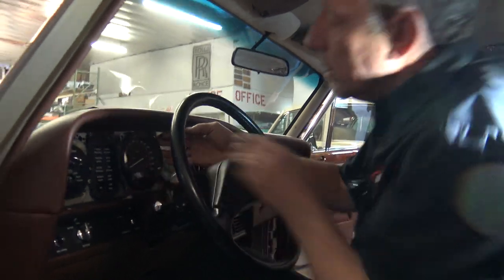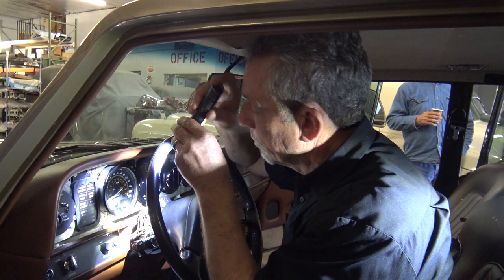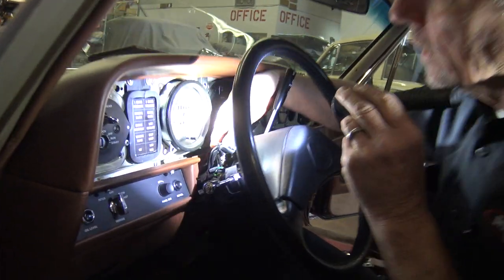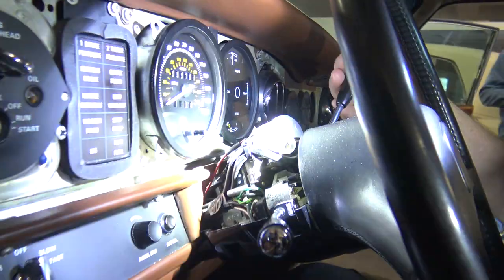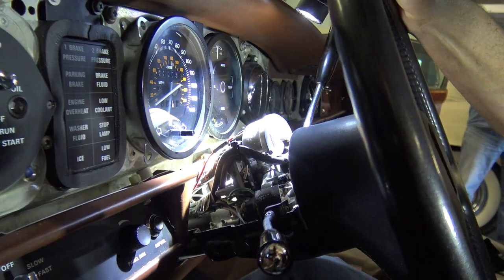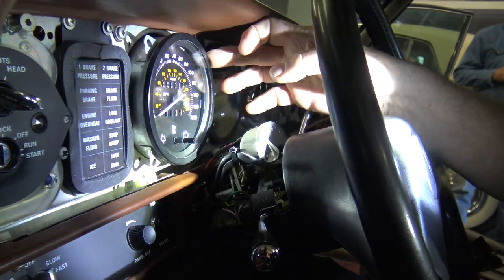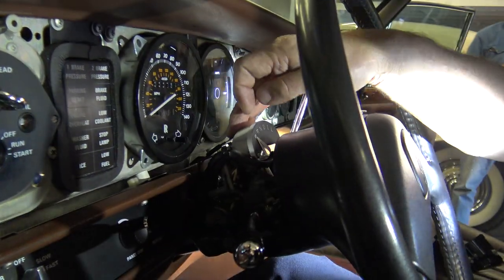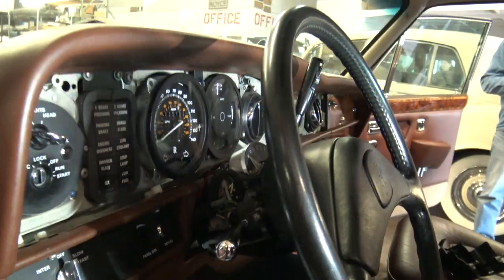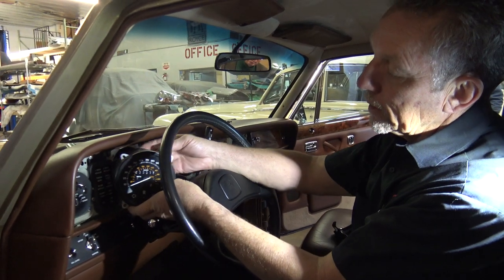So now, one thing you want to watch out for — this is where disconnecting the battery is important. There's a wire up here on this gear shift lever, this little thing right here, that tells the transmission what gear to go in. That's hot. Now I have the battery disconnected on this because I got the doors open and I don't want it to go dead. But if you touch this metal against something hot and the other metal, it's going to short. You're going to get sparks, you're going to freak out and probably break something because you'll react. See how much easier that comes out now.